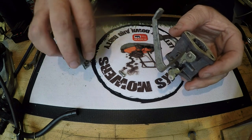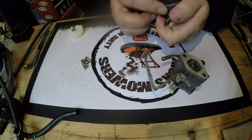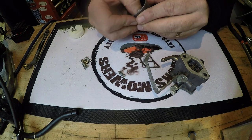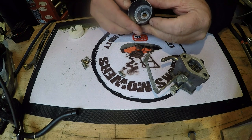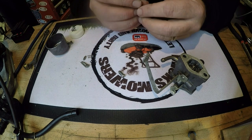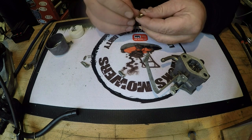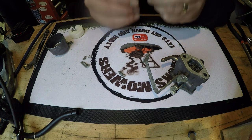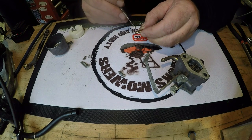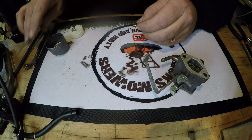I'll try and get most of that off but a lot of it won't come — the carburettor is actually now damaged. But I'm hoping the rest of the carburettor itself is okay. The throttle was not running freely, but as you can now see that's now running as free as a bell, which is good. And the choke was working anyway. Let's have a quick look inside the bowl. Yeah, the bowl has come up really well — very happy with the bowl. Again there's a bit of corrosion still in there. I'll just get a wire brush in there, just knock some of it off if I can. The main jet is now clear and looks to be very clean. So I'm happy with that. Double check that it is clear — it does look clear. Yeah it is. These were all bunged up before, so that's good.